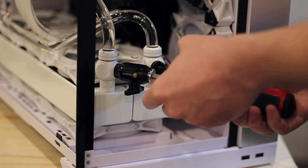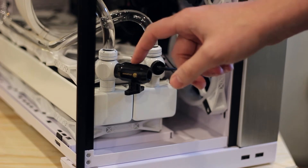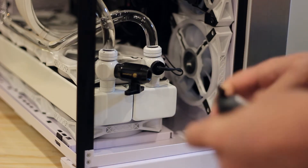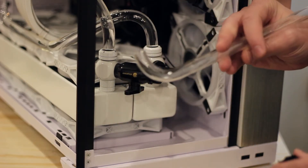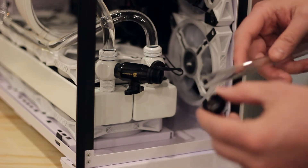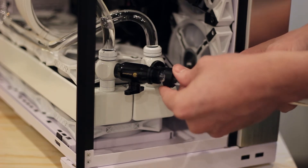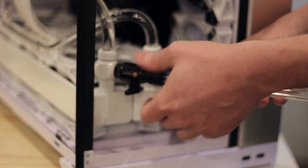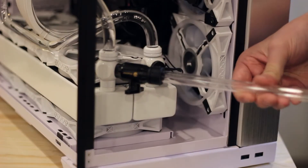With a drain valve, you can easily drain the fluids from your system without worrying about leaking everywhere. I installed a Bits Power black drain valve, and I'm going to install a G1 quarter EK fitting. We've got a drain tube we created from a bend that cracked at one point — we just salvaged that to use as a drain pipe. Slide the tube in carefully, as there is a rubber seal in there. Screw it in not too terribly tight; the seals are holding it in place. And now we have a drain spout.